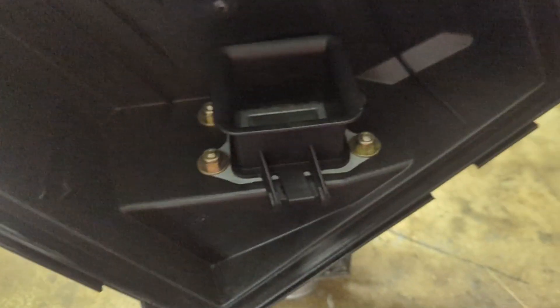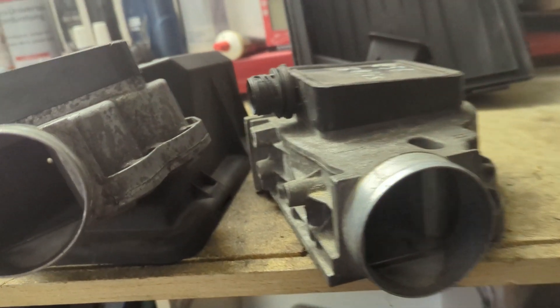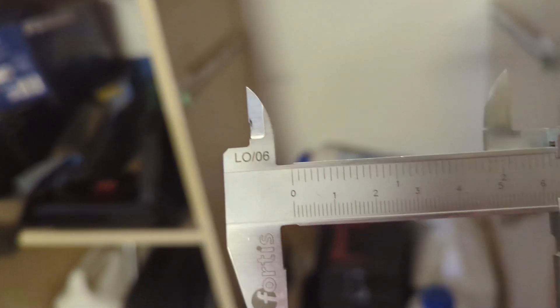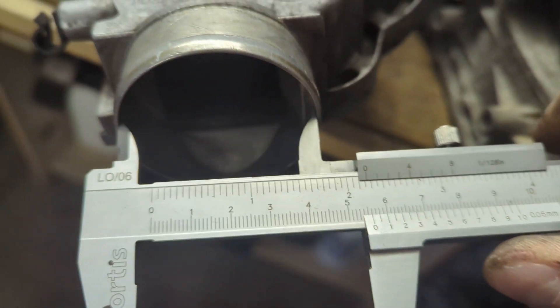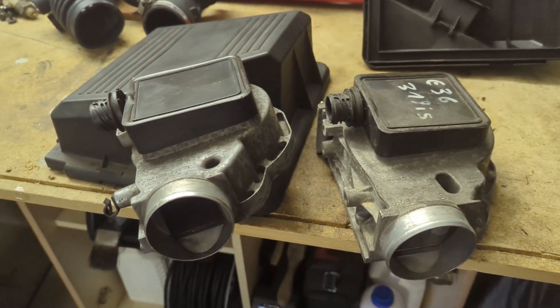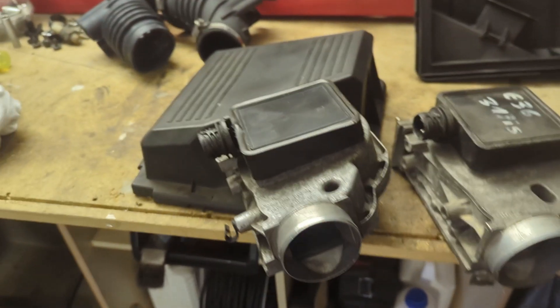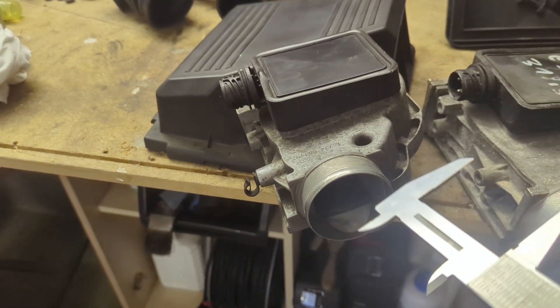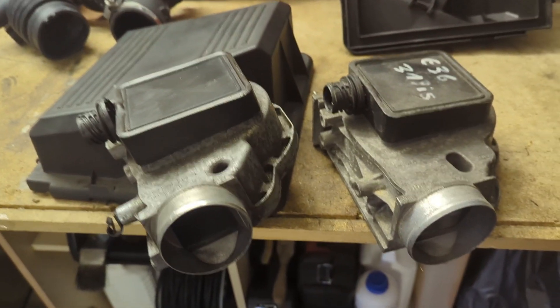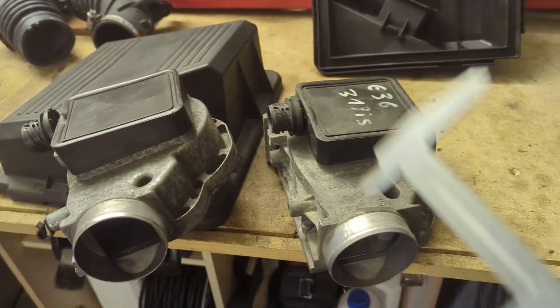The housing dimensions — same width, same height — are interesting. Now for the other side, it's obvious: this is the B16 and this is the B18, and it's just a huge difference. We measure here and we have 65 millimeters, and here it's only 56. You can just visually see a huge difference. So while they keep the air box the same, they make this part bigger on the B18. Either this is a deliberate throttling measure on the B16 to keep it low on power, because the air box is the same but the actual airflow meter is smaller.